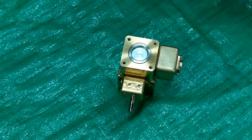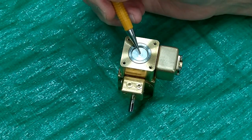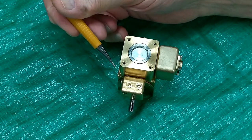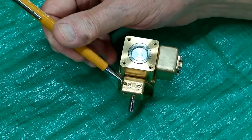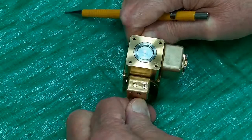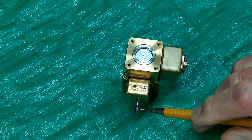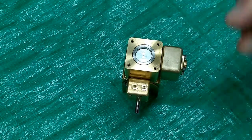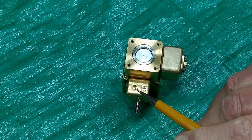I have reinstalled the piston and we are at top dead center, which is the end of the exhaust stroke and the beginning of the intake. At top dead center, I've put a mark on the crankshaft with a sharpie. That's just another reference — you want to look at these two followers.